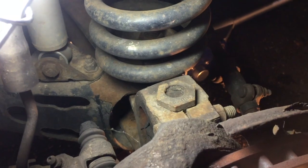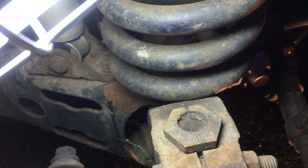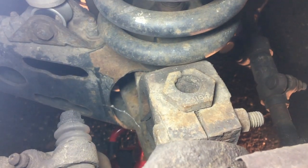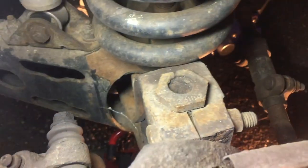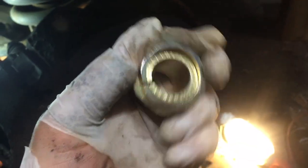For this fix you're going to want to take off your wheel and tire to access the camber nut. That big thing right there — it's adjusted all the way in. You can see the thin side isn't quite centered, so the wheel is tipping too far out giving too much positive camber. We want to change it out with something adjustable — mainly this aftermarket camber nut — so that will go right there.